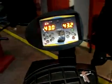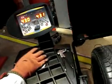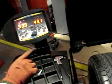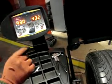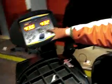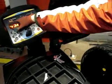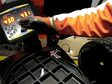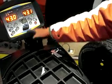So now we enter into the testing program, so testing the signals for the pickup sensors. Because before we have an error 026, and there is no A, that means the pickup sensor A is no signal. And we can see the two values here, the two windows. This window represents the pickup sensor value A. And then this one is the pickup sensor value B.